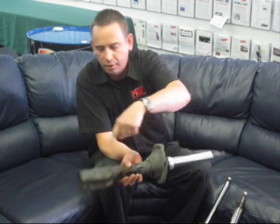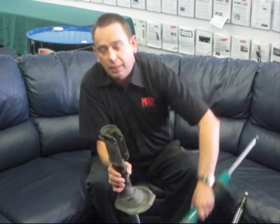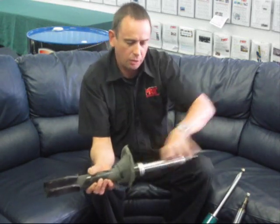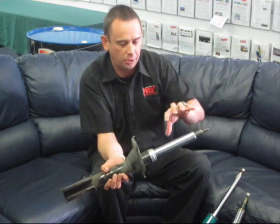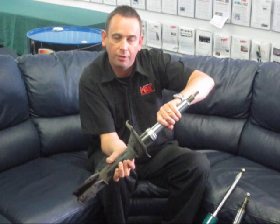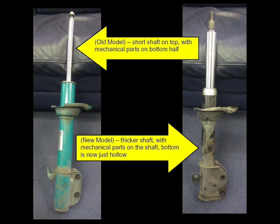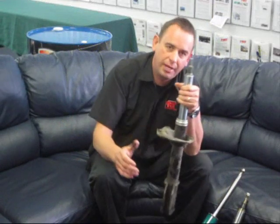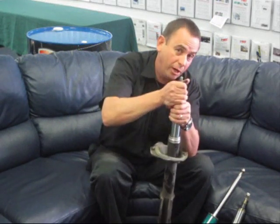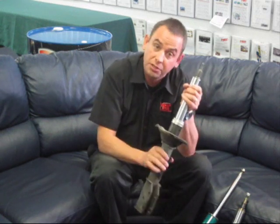In the inverted design, the outer tube is just a hollow body with a rod that connects to the bottom — you can see it has a big nut at the bottom. If you undo that nut, the whole assembly pulls out of the body, and you have the mechanical acting part of the shock absorber and the rod at the bottom. This changes the dynamics of the suspension by changing unsprung weight, because the heavy part is now at the top connected to the body.